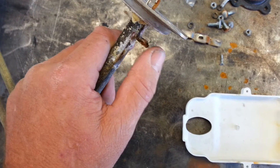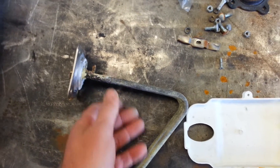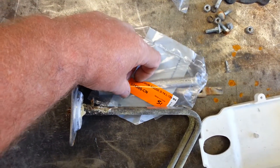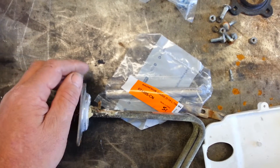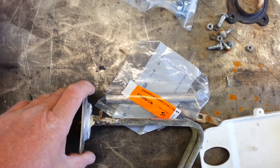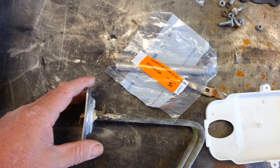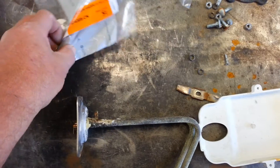Attached to this little tab right here is an anode. These are either made out of zinc or magnesium. I've got a new one here — this magnesium anode just screws in right there and I'll be installing that when we put it all together. What it does is sacrifice itself within the unit instead of corroding the unit. When I took this apart the anode was completely disintegrated, just in the form of scale and rotted material down in the bottom of the tank.